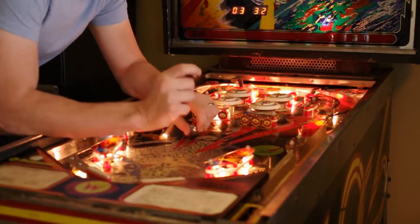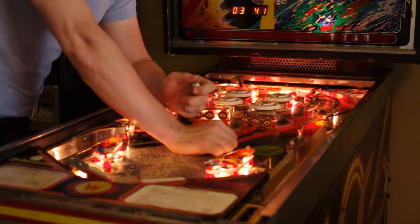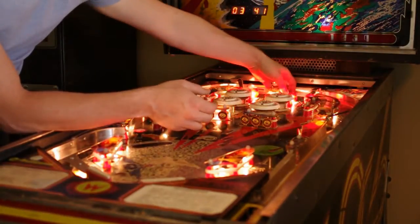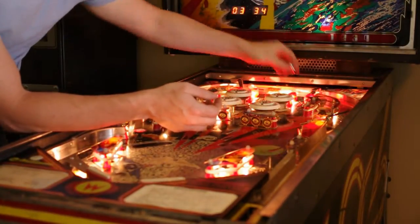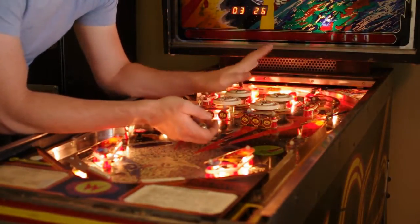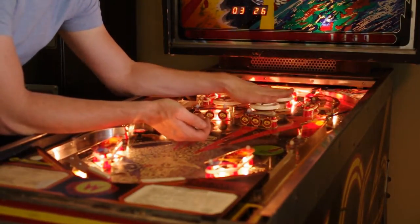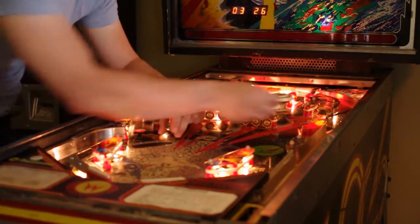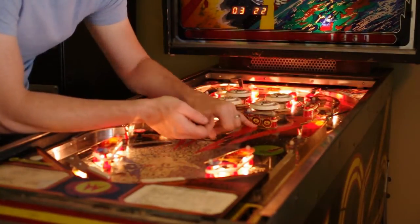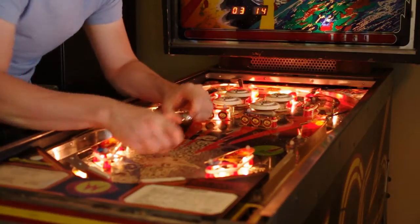Highly recommend using a ball because just because I can press a switch here with my finger and it activates doesn't mean a ball is going to do it. This is particularly important with rollovers like up here in the fire lanes — you want to actually use a ball and make sure it will activate the switch. Also, because of the way the special solenoids work, it does keep your special solenoids active. It shows you your pop bumpers are scoring because there is a separate switch for scoring as opposed to activating it.